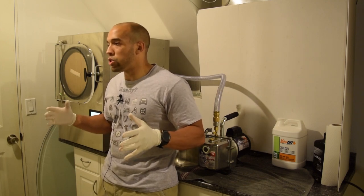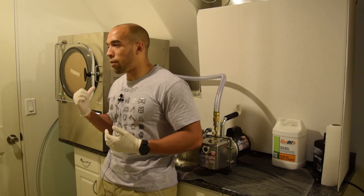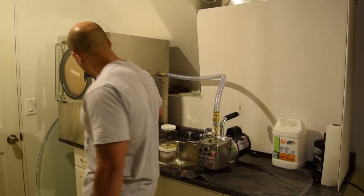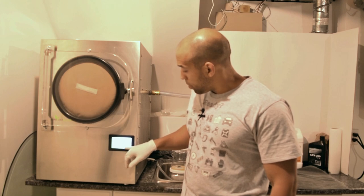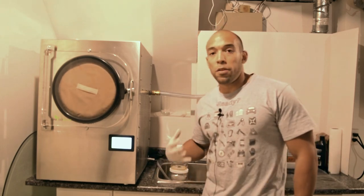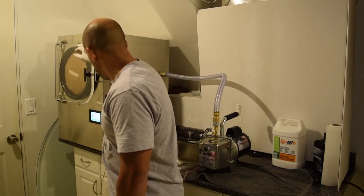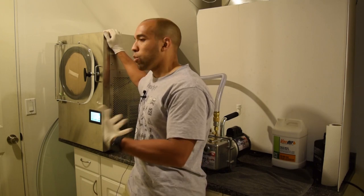Fortunately we have a room in the house isolated from the rest of the house where we're able to do this without it being too disruptive. Some people keep their Harvest Right freeze drying machines in the garage. It's really only as loud as the vacuum pump; the machine itself is not that loud when it's freezing. We're going to pull the switch now — cancel — and it's going to ask us do we want more dry time or to defrost. We're going to open the drain valve right here. That's going to release all the built-up pressure and allow us to open this door to access our food. Before doing that you wouldn't be able to open this door; there's too much vacuum pressure.